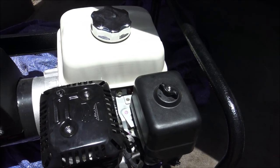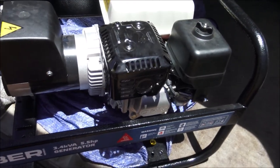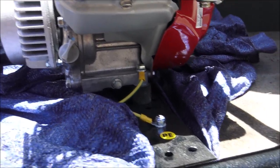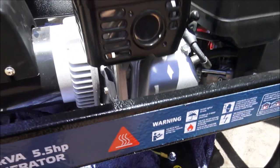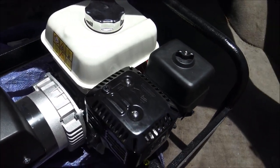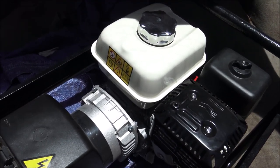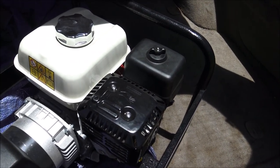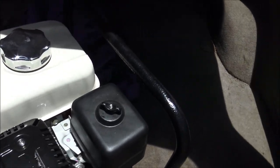The other one I showed you — the problem is that when you want to get in and service it, change the oil, there's your oil plug there and one on the other side, plus a drain plug there to drain the oil out of the sump. On the enclosed ones, they are so compact that you've virtually got to pull the whole casing apart to get to the servicing components such as air filters, fuel filters, any other problems that may crop up, including the spark plug. And believe me, it is a pain in the butt.